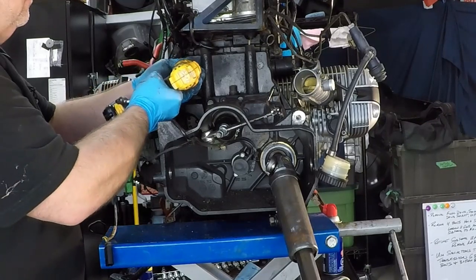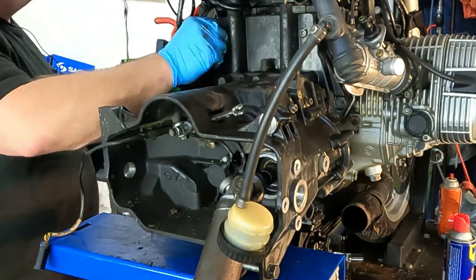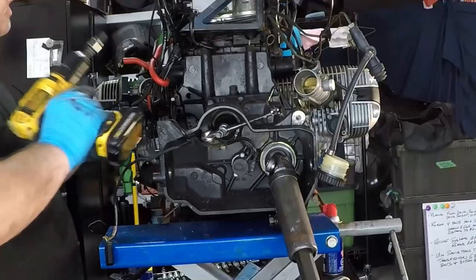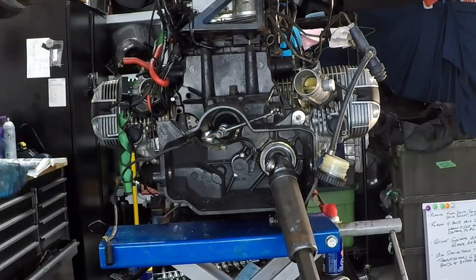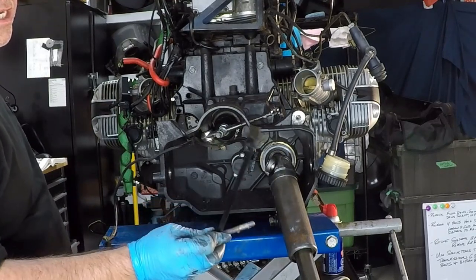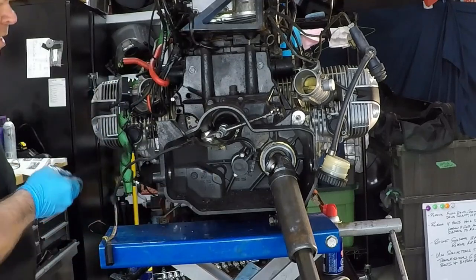You do need the bolts to pull the transmission on the rest of the way. Otherwise, you'll be fighting against the clutch spring. The clutch spring is what's holding this stuff back now. So, without the transmission bolts helping you get this on, you're gonna be here for a very long time. Just remember that the bottom of the transmission has this bracket that has a mount for a tie down on it. So that tie down goes on the right side of the bike.